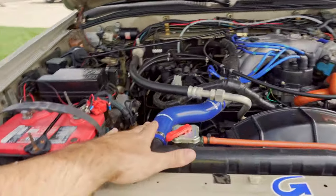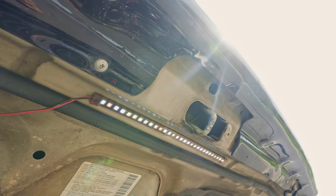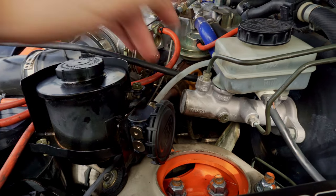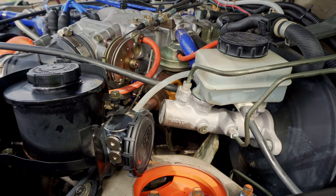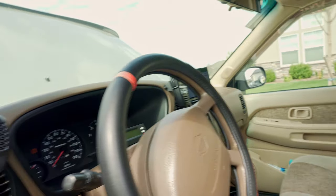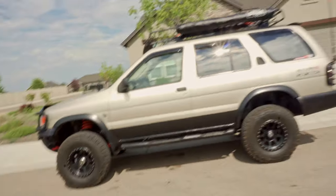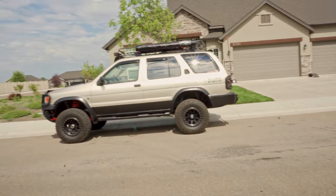The engine bay here — we've got silicone coolant hoses, silicone intake hoses. My favorite contraption is this switch here, which controls that light. We have the diff breathers routed all the way up to the top now, with the front diff installed today. Rear diff, front diff, breathers — all the way up to the engine bay. The interior has CB, GMRS, and NAV. This is going to be, in my estimation, kind of a flagship R50 build for a lot of people to watch and enjoy.